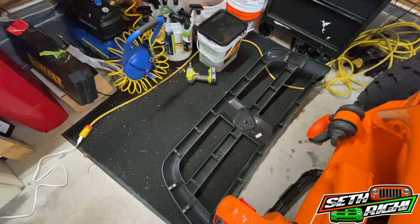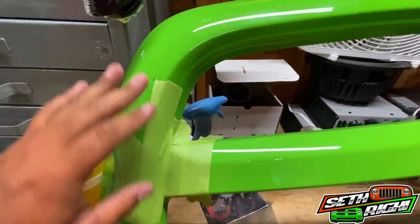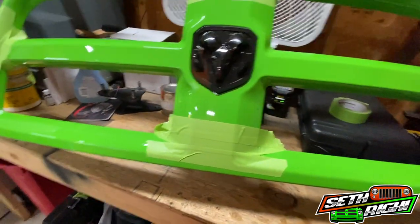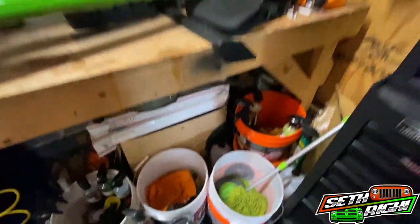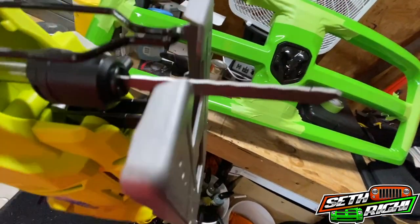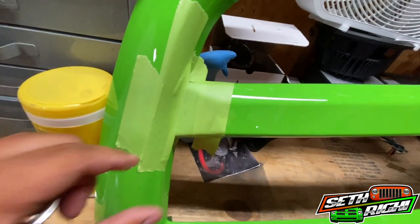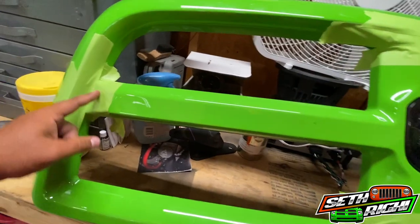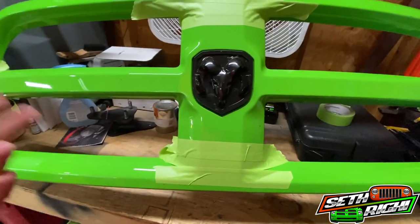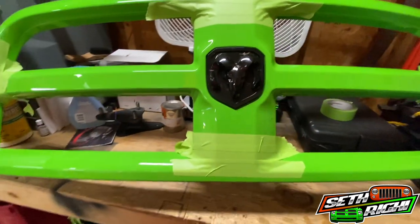The next thing I did was get some painter's tape. I taped up around where I'm going to cut — I just don't want the jigsaw to rub up against the paint and scratch what we have left. It's green tape, so almost the same color as the grill. To save a little aggravation, I went ahead and bought a blade kit and I'm going to use the real fine metal blade — brand new. We'll try that, hopefully it cuts. It has adjustable speeds, so we'll use that. You want to leave a little bit of gap — don't cut right on the edge of the line. Leave like a quarter to a half inch. It's better to leave too much than not enough. We'll cut it out a little further, get all four sides cut, pull it out, and see how much more we need to trim after that. It's easier to go back and trim again than to cut too much and have it not fit right.